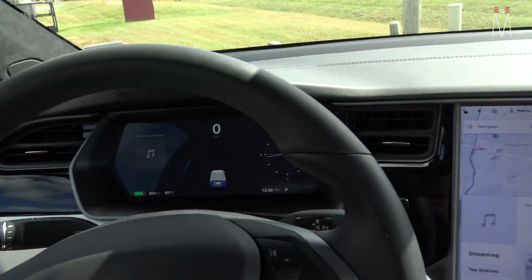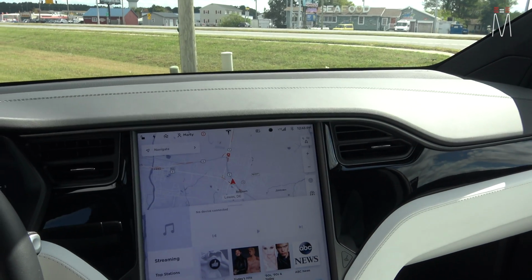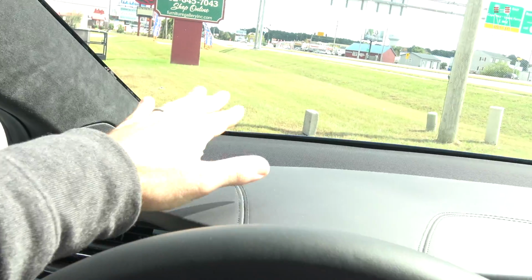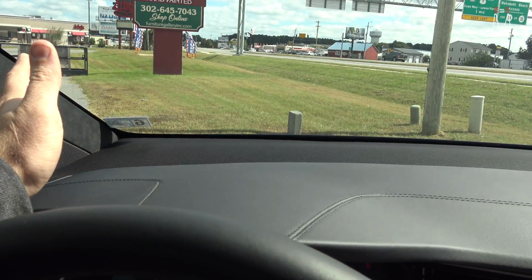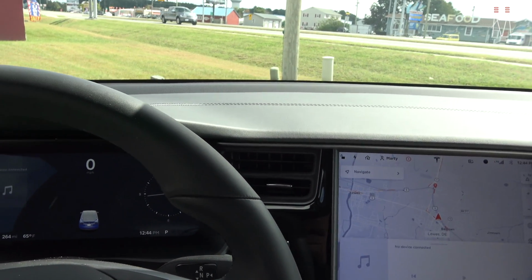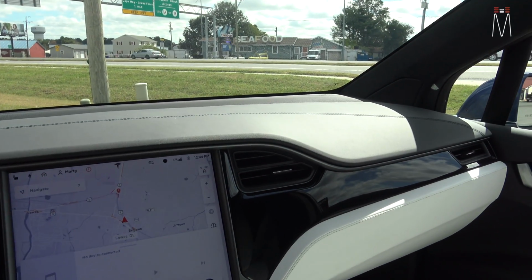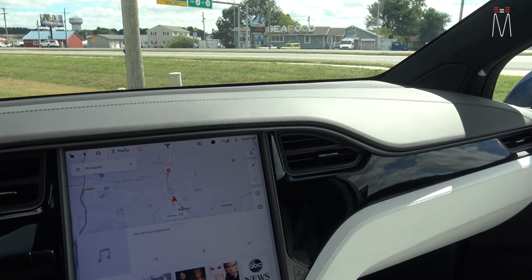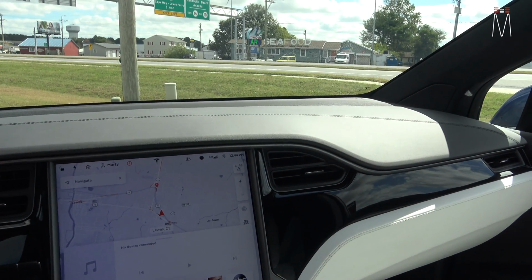So you guys have seen me do a lot of pillars, talking a lot of times about reflections, things of that nature. Obviously, we don't want reflections if we can help it. We don't want to play a speaker directly into a reflective surface. In this case, we have glass. Because at that point, the frequency response is going to change. The EQ is going to be much tougher to nail down with a reflection. When you have a speaker going into a reflection, it's going to do what it does, and there's not a lot of control that we have on our side because of that reflection.